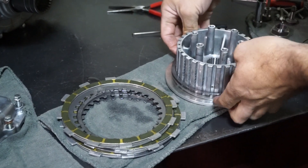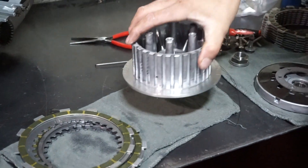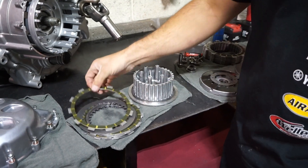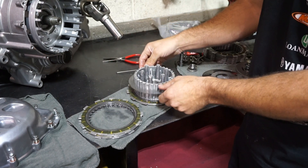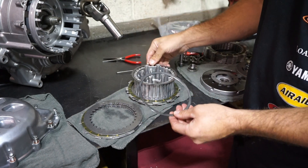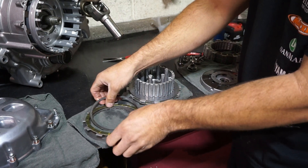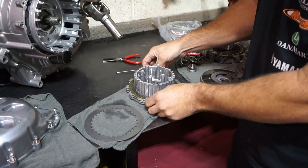When we go back together, you'll probably have a stock clutch you're going to replace. You can strip it all the way down to basically just the hub. Then there's going to be a flat washer — these are just flat, it doesn't matter which way it goes on. And then that bevel washer — it says 'outside' so that needs to go outside, just like that. Then do your friction, your steel, friction. Another set of bevels: a flat and then your other bevel, same way the first one went on. Line them all up, another steel, then friction, flat, and bevel. So it's three sets exactly the same, and then your last steel.